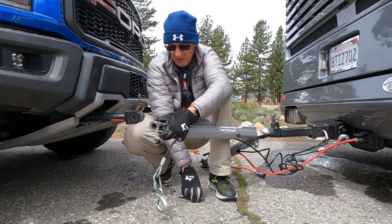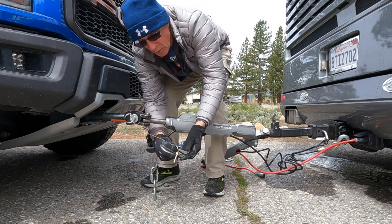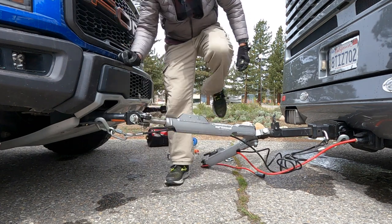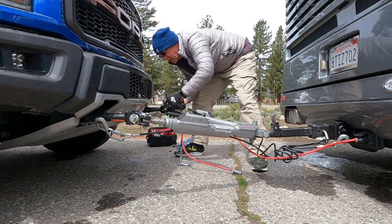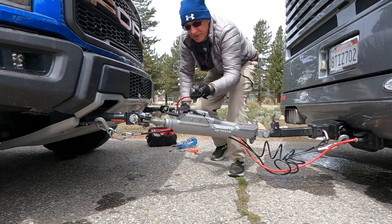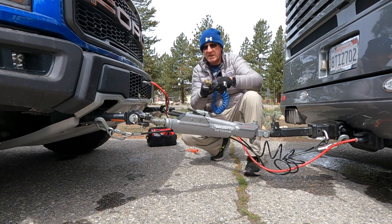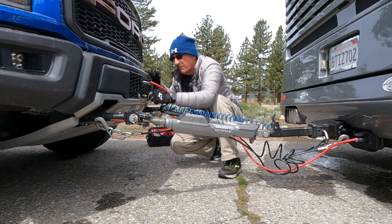You can get in the ballpark and look like a pro every time. These are linchpins — you have to make sure the bail on the linchpin will go over and around the end. If it does anything other than that, it's incorrect. I connect my safety cable hook, step over to the other side, connect my pin, put the linchpin in, and you'll watch the bail flip over just like that. Connect my safety cable, take my electrical connection — it has a locating groove on the top that has to correspond on the truck. It goes in, and a flap provides a lock so it won't get yanked out. My airline goes from the coach to the truck, which feeds the Air Force One brake module.